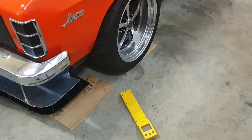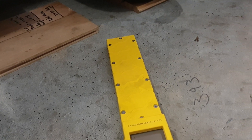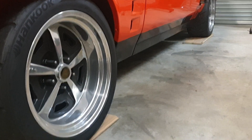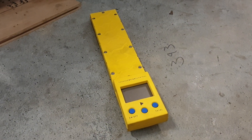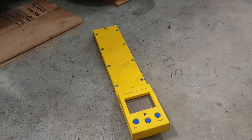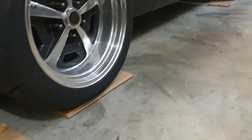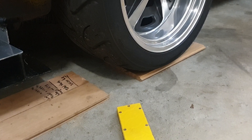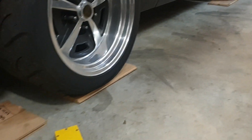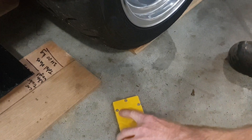I just want to get an idea of how it's faring up. This is a caravan scale — you can buy these on eBay. They're a great little thing for cars and trailers; I've worked out my hitch weight off my trailer when the car's in it. This one is capable up to 1500 kilos. I've set all four wheels up on floorboard — around three-quarter inch — so I can roll it onto the scale and off again, giving a nice even platform to use the scale.